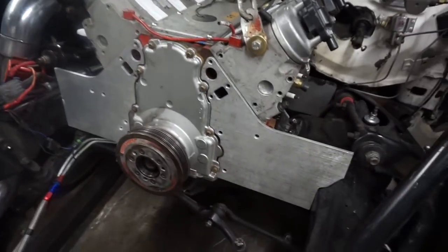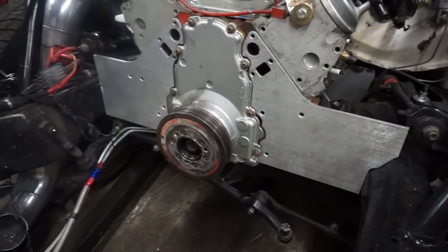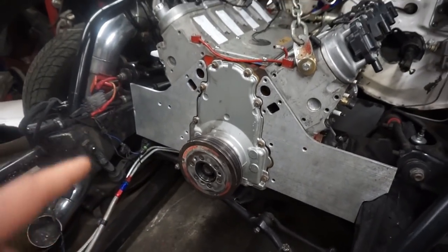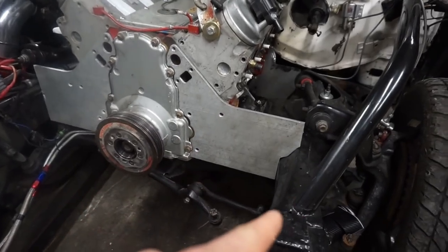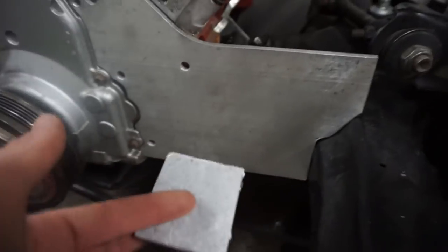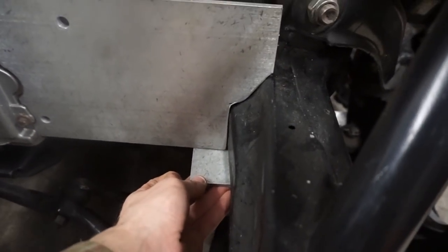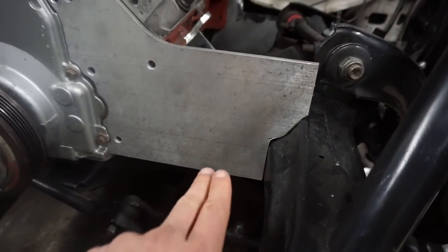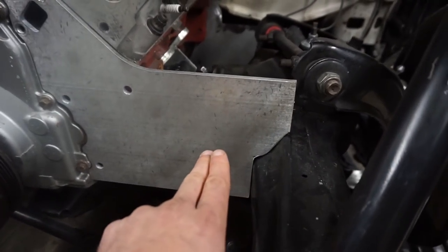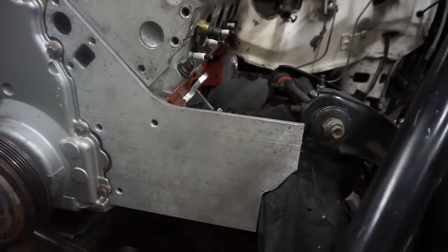Hey guys, as you can tell, I got everything trimmed and fitting inside the frame. I'm just going to figure out how to make mounts on the chassis in order to bolt the motor plate to. Ronnie was telling me to build a shelf for it — I'll use this piece of aluminum just to show you guys, kind of like a shelf. So when you drop the motor in, it can actually sit on the shelf and then you slide it back onto the transmission. It just makes it easier for install, and then you just put the bolts in after to bolt it down.